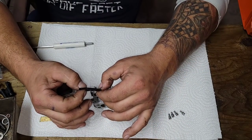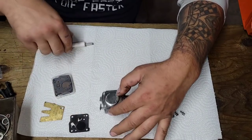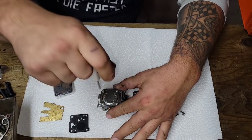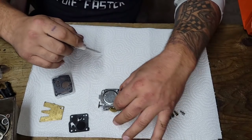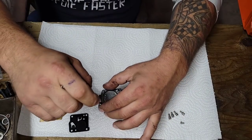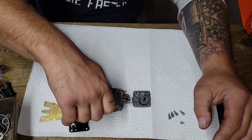If it's a 50ZN14, that is a 268, okay? I get asked that quite often. So the 162B is the early carb. So you can tell if you have an early saw based on that. Now there's other things that make an early saw.